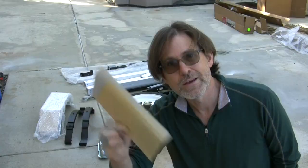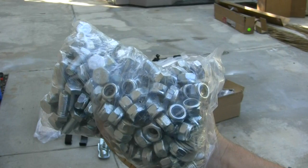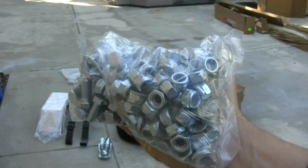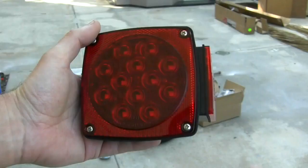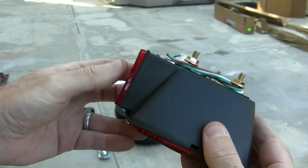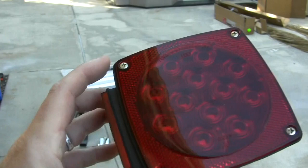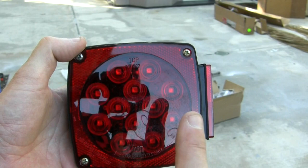That's a big old bag of nuts and bolts. I notice they're all nylon lock nuts, so they're going to go on once and stay on. These light assemblies look sealed well — the case is all molded one piece. They look watertight. There's silicone where the wires go in. The LED thing is key for me because my car has LED lights, so the circuit cannot handle a lot of amp draw, and these won't draw a lot.